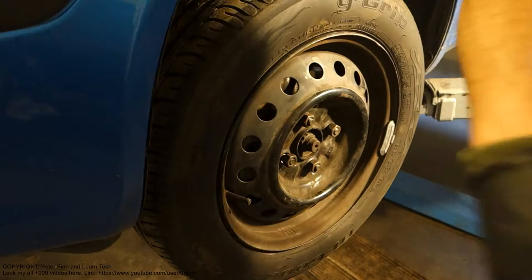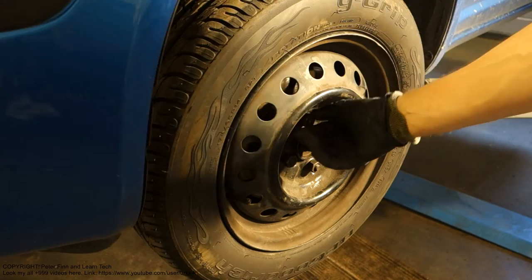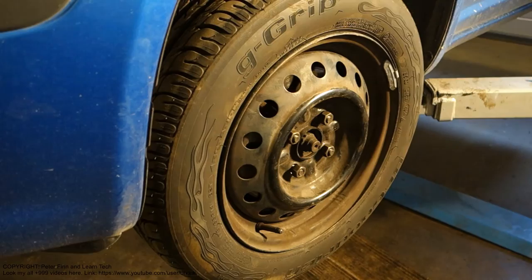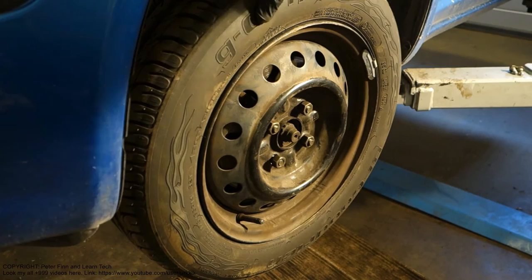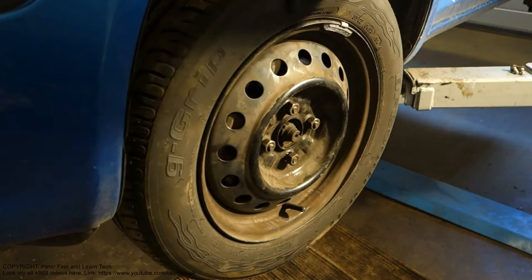Normally there are a couple of basic issues inside these brakes, and next I will show what these issues are. First we can test by trying to rotate our wheel, after we have lifted the wheel up so that it is in the air. This is the first step, and then we need to put the gear in neutral N position in an automatic transmission, and in the neutral position in a manual transmission. That means our gearbox is free and we can rotate the wheel.